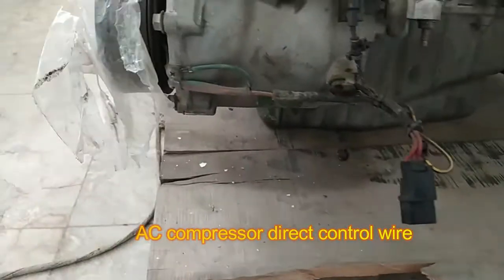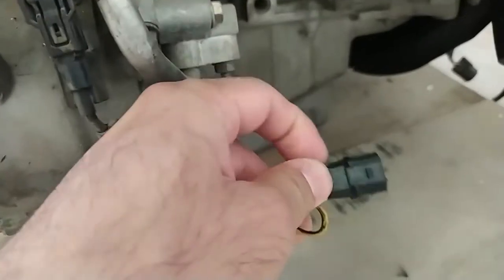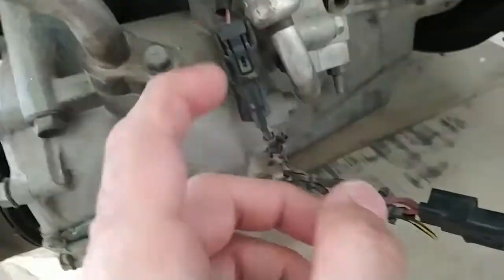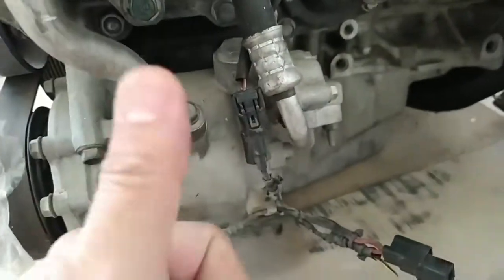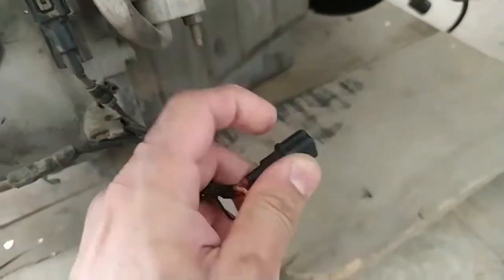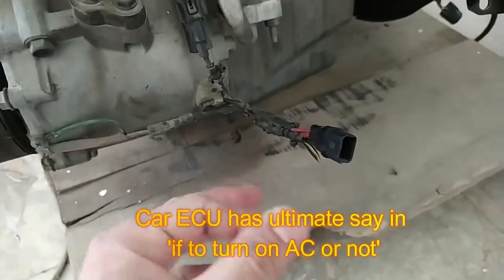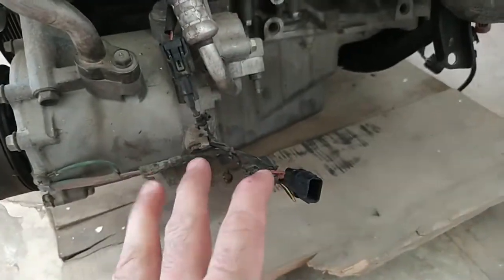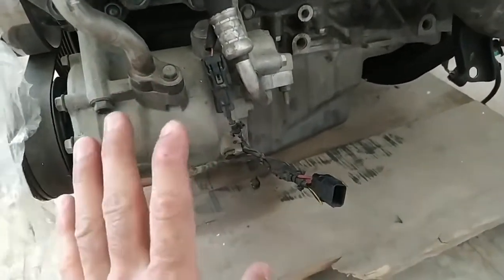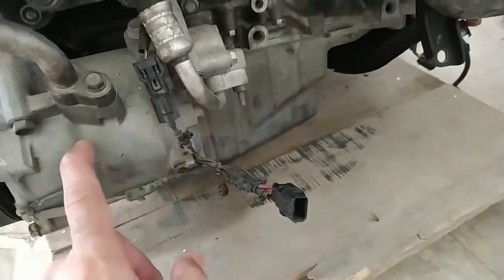According to the AC compressor, I think I did not cover enough details. The AC compressor has two controls: one input is coming from the ECU via the wiring harness, and the other can be from when you press the air condition button inside. When you press the button, it is again the ECU which says ok or not ok. Sometimes the ECU thinks it is not safe for the engine to put a load on the AC compressor — if the engine is having some problem or you are running it hard, for example at full throttle — then even if the AC button is pressed, the ECU will trigger it off.